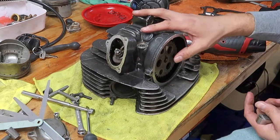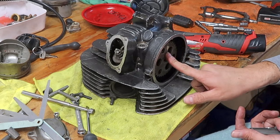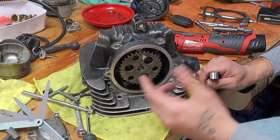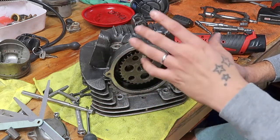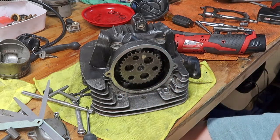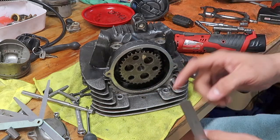So I'm going to include this in the video, probably before actually showing you guys how I check the valve clearance on this thing. But I kind of messed up because I forgot that the timing mark, which is this, when you put the sprocket on right here with the little lip or the little stud that's right there, I don't know what you guys would want to call it. It has a little line right here, and then it has a line right here, if you guys can see that. So that is basically you're at timing. So then you can do the valve clearance on your quad here. So make sure everything's to spec. So basically, I just redid everything, and then rechecked it. But obviously, I will show you guys how to do it in this next clip, and I'm just going to put this in the beginning.